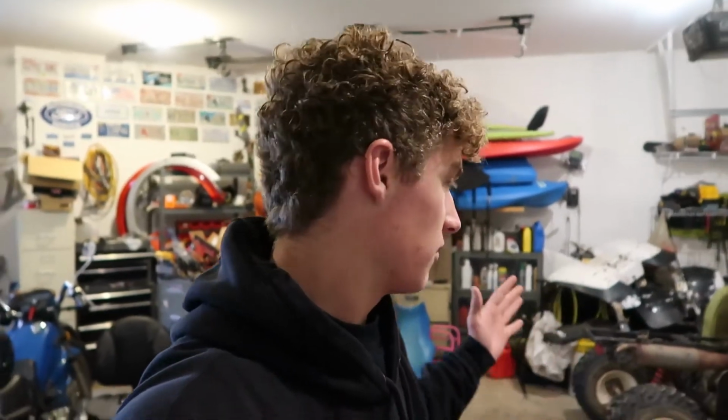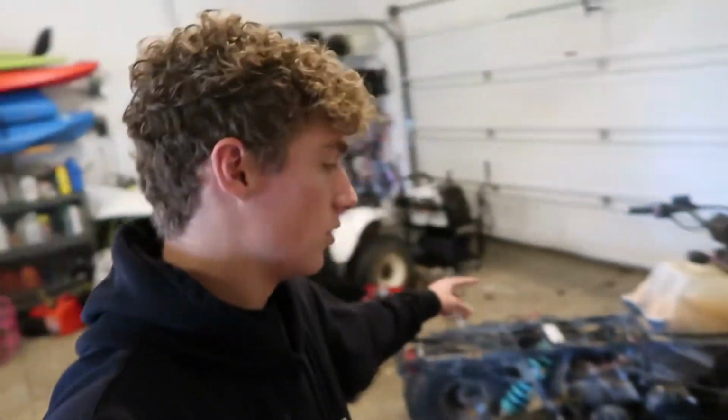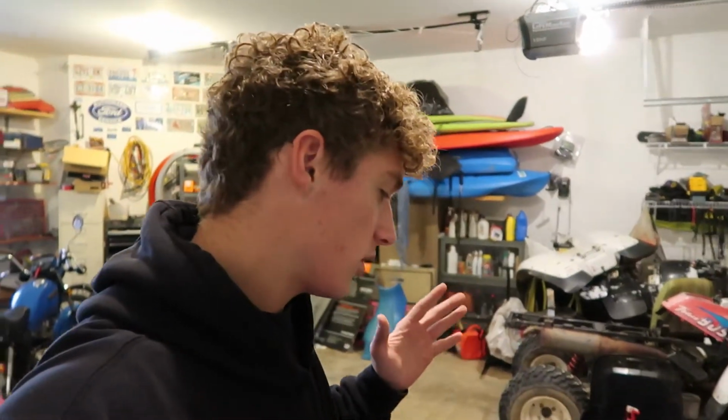Okay guys, so it's a different day, as you can tell, different outfit, but yeah, after trying to get this thing running with the new cleaned out carburetor, not new, but cleaned out carburetor, it still had a really high idle to it, and I did a lot more digging and research on what it could be. So a lot of people were talking about crank seals, but I was reading and somebody brought up the idle or throttle adjustment at the top of the carb.